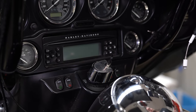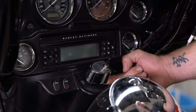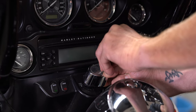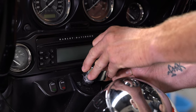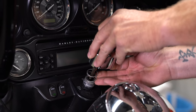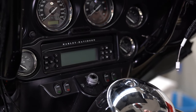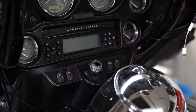The first thing we're going to want to do is remove this inner fairing, and to do that we need to remove the ignition switch. Right underneath there where he's putting his index finger, there's a button. You want to push up on that button — he's got his key in there and we're in the four o'clock position. With that button pushed up, he's going to turn his key counterclockwise and you'll feel it release, then just slowly lift your ignition. Do not turn your ignition at all while you're pulling this out — there's a spring he's going to have to grab too. If you do turn it, you can misalign your ignition. We do have a video on this channel on how to fix that situation and realign your ignition.